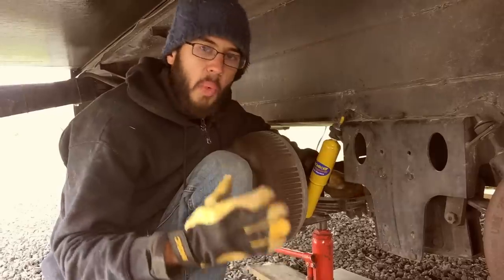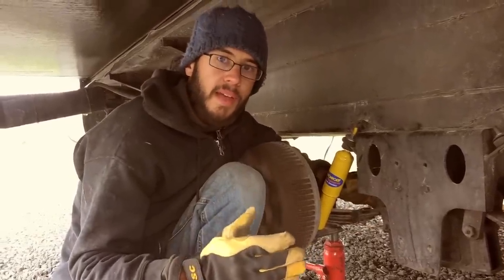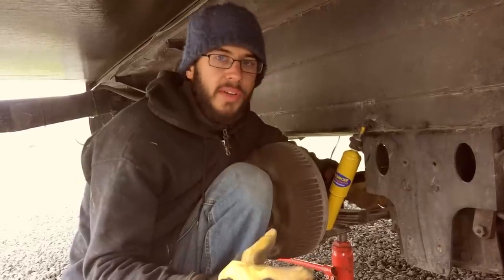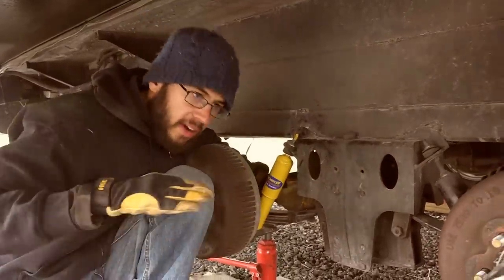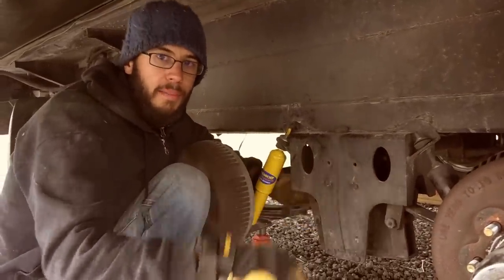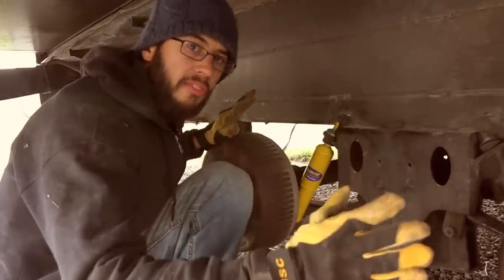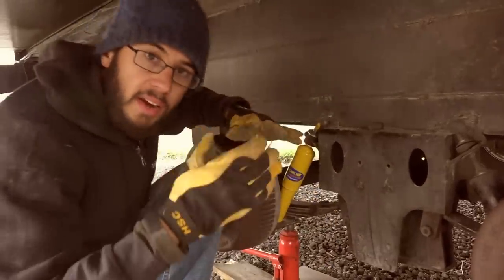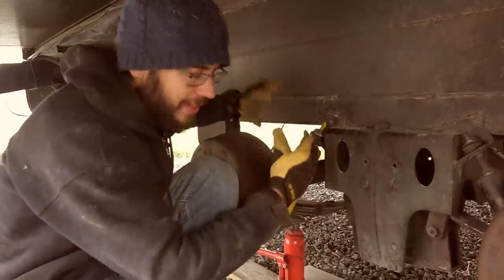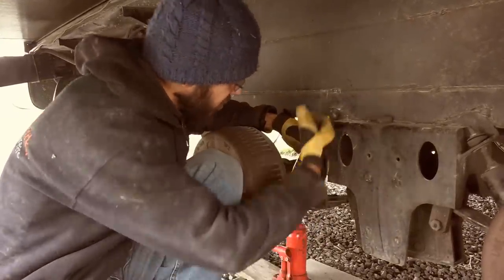It's definitely a worthwhile thing. If your trailer doesn't have shocks, you should add them — you can almost always tell a trailer that's missing shocks going down the road because it bounces a lot. Ones with shocks kind of float down the road a lot better. We are replacing the shocks with the tires off, but you do not have to do that. We have the tires off because we're also rotating our tires right now. You can crawl underneath and take apart these bolts.